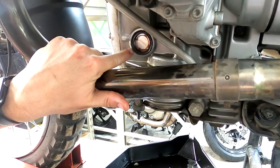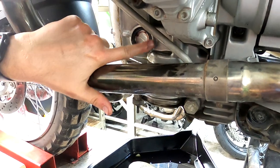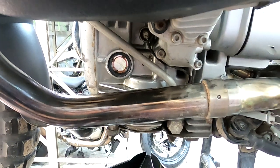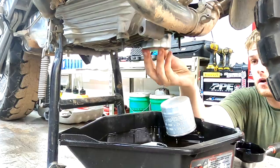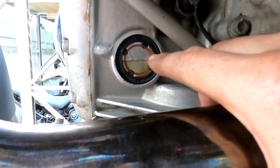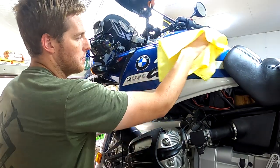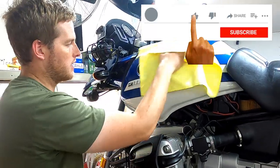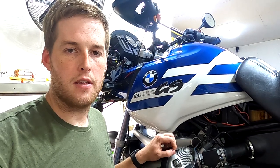Check it again — feel it. Right there looks just about perfect, and that's all there is to it. Now we're going to refill our engine with fresh engine oil, spin a new oil filter on, and reinstall our skid plate. There comes the oil and it'll stop at the middle-upper level of the sight glass — perfect. Thank you so much for watching this oil sight glass installation video on this beautiful BMW R1150GS. Please remember to like, comment, subscribe, and go to bmwpartsguy.com for all your BMW parts needs. Thank you and have a safe ride.